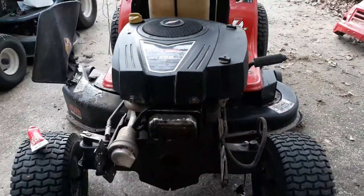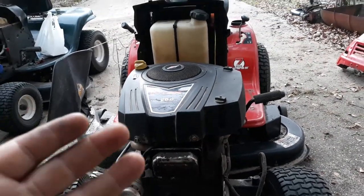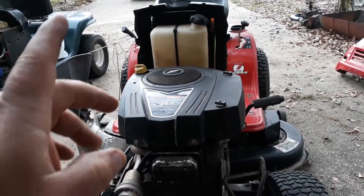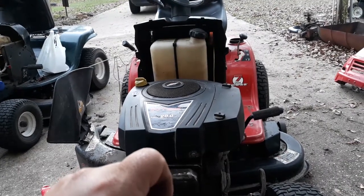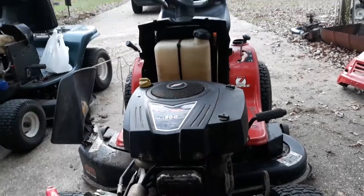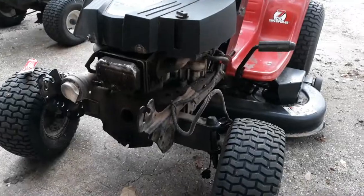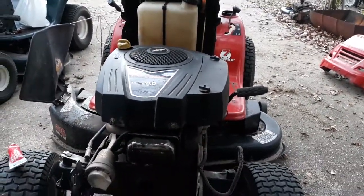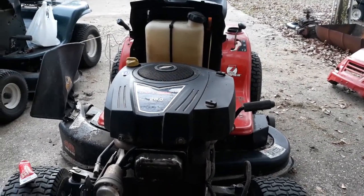But on this one, there is no oil filter anymore. The 13-horse didn't have an oil pump or oiling system — it's driven off the cam. Since I took the cam out of the 13-horse without the oil pump, I couldn't run the original oil pump. The crank case at the bottom of the motor came from the 13-horse, which did away with the oil pump entirely.